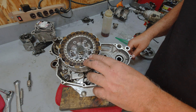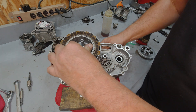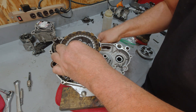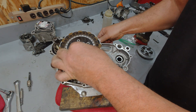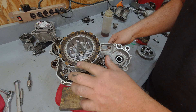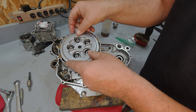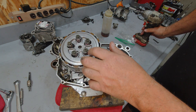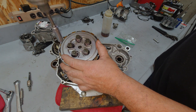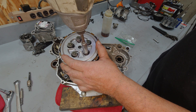Now as these clutch plates go in, it's going to get more and more difficult to turn this thing. The engine itself, because it's a lot of horsepower, it's not going to have a problem spinning this at all. But once we get a little bit of oil in here, it won't drag quite as bad. And once you clamp this down, it's going to be locked together. Always want to tighten your clutch nuts slowly, incrementally, in a cross pattern to eliminate or potentially eliminate any kind of warping.